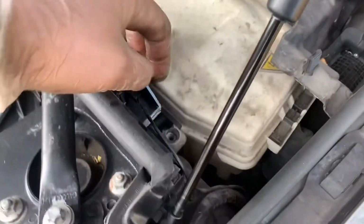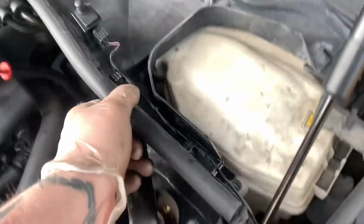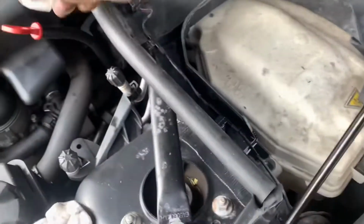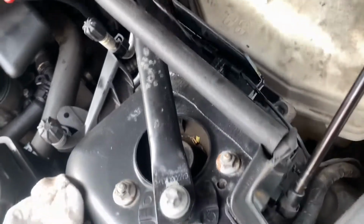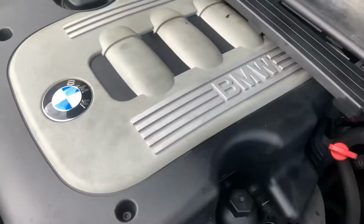Right, next thing to take off. I need to get this off, so I need to see where that's bolted on. I'll find that and then I'll show you. Right, so we've taken these covers off on both sides, and then there's an 8mm bolt there, and that gives you a little bit more manoeuvrability. So now we need to disconnect these wires and pull this out of the way, because I'm going to be pulling this off. This is on little clips that slide off. But I have to leave that in place, probably be easier. So I'm going to just pull all this off anyway, and then I'm going to come back when all that's off, and I'll take this engine cover off as well, which once that's off it's just a few bolts, and then we'll start from there.